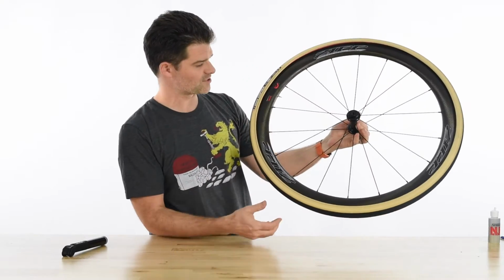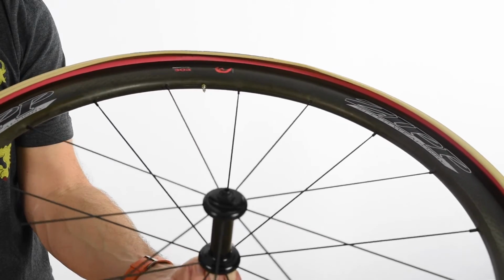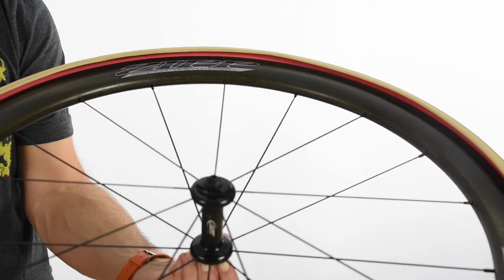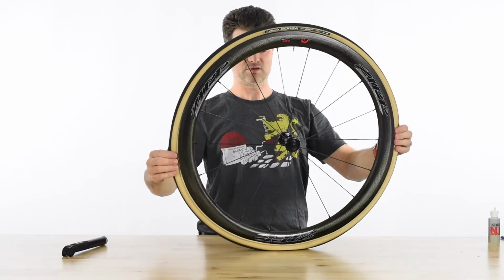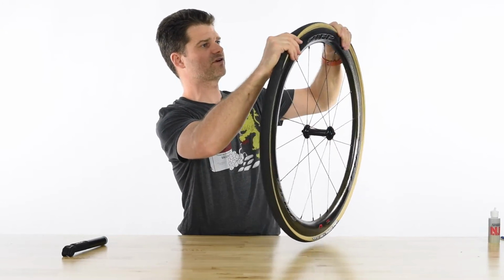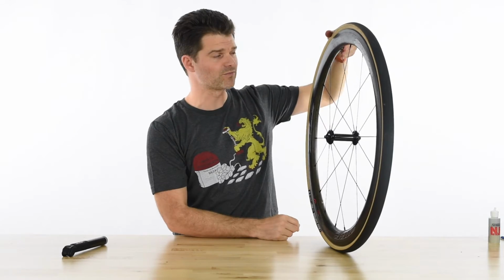Okay, see the difference? Now if we look in here all around, we just have the littlest bit of inner tube poking through, but it is completely inside the clincher well. Now we can start tucking in the second bead. Take it here. I'm going to work the full perimeter around very gently, and now I have these last few inches, which are going to go right on for me because I've got my thin rim tape.